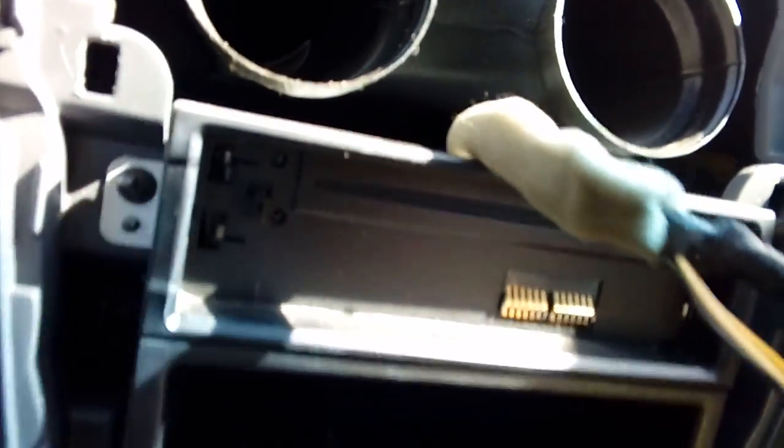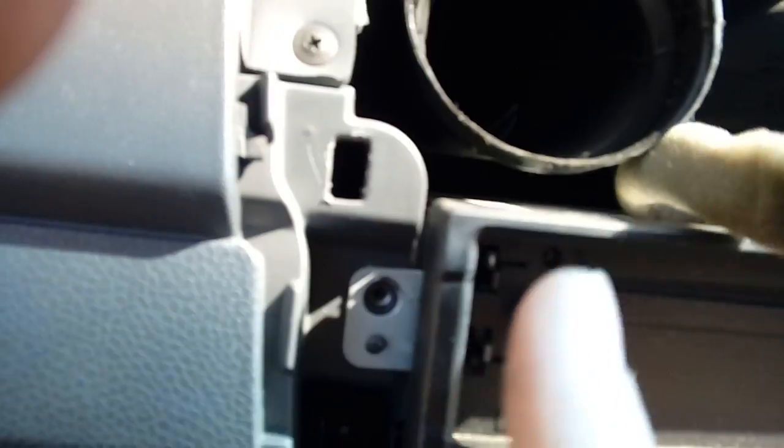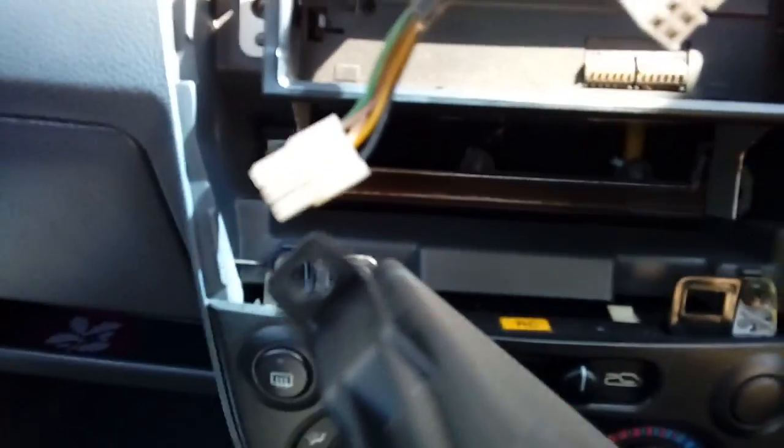There's the back of your trim where you've unplugged it from — put that safely to one side, you're going to need that as it's a big part of your dashboard. You're left with basically a Phillips cross-head screw: one here and one on the other side. Undo both those screws and your radio and the pocket will come forwards. The two screws at the top are undone — now go to your hidden sunken ones down here, there's one each side, and it's a Phillips. You'll need a long, magnetic Phillips screwdriver for those.